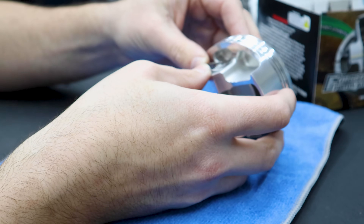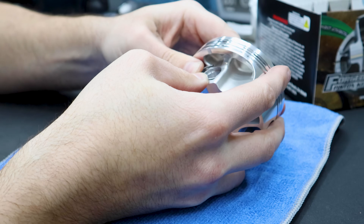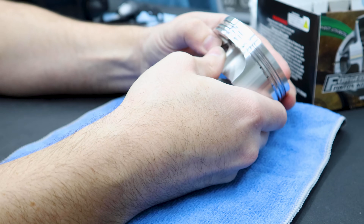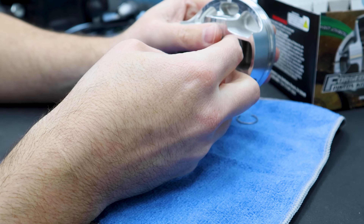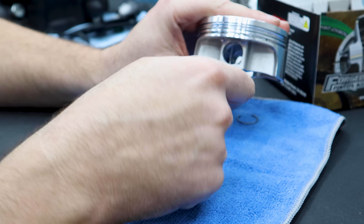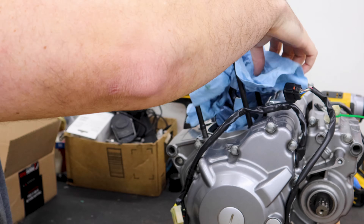For smaller pistons like this I can usually just do it with my fingers. This last little bit I might need a screwdriver — I'm feeling it... and I got it right at the top where I want it. The reason I didn't put it at the bottom is because there's a little relief there to get in with a pick and take it out, so the top position is better.